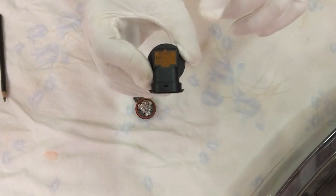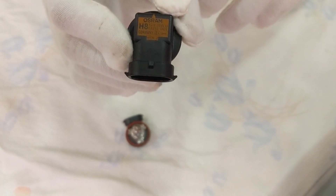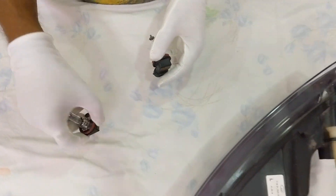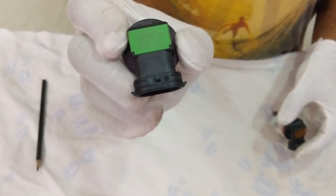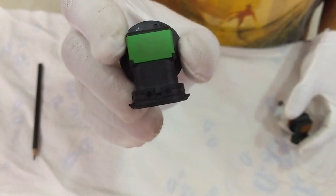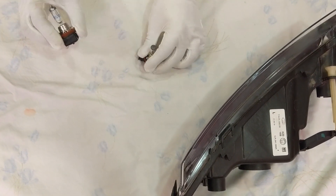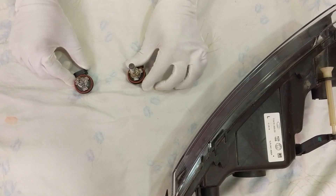What happens with the H8 is it's a 35-watt bulb which has less brightness compared to H11. The H11 has 55-watt bulbs, so it has better brightness and coverage on the road. The question is what is the difference that does not allow you to directly fit the H11 in the H8 slot.